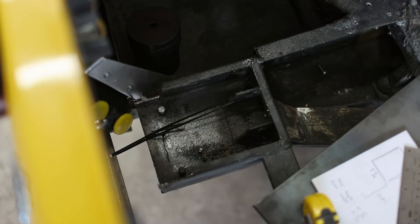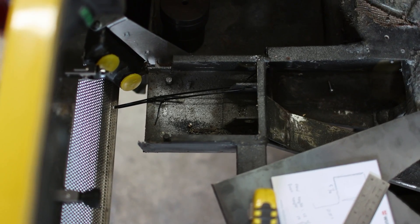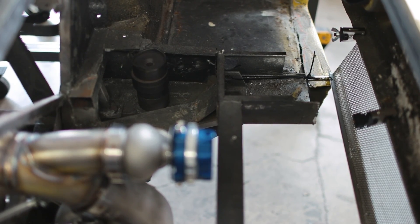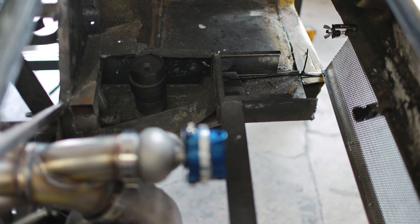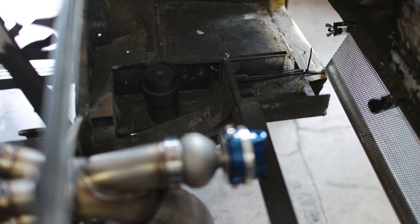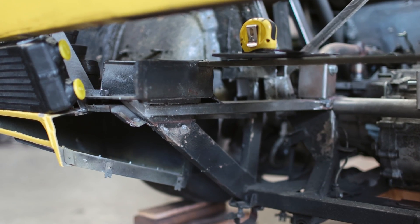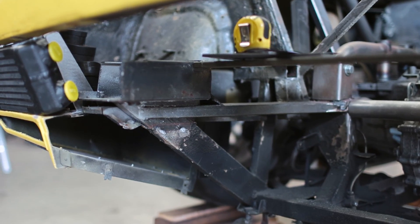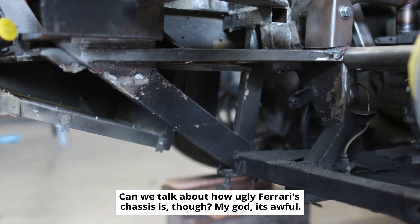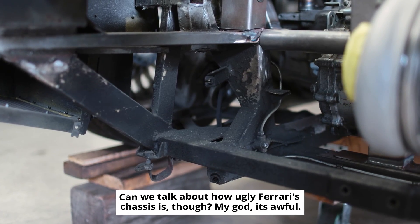I'm taking measurements so that we can start building rear wing uprights, and I've mentioned previously that I'm going to mount those uprights to these boxes at the back of the chassis. They are originally rear bumper shock mounts, which means they are heavily reinforced and tied into the chassis rather extensively — perfect for what we're trying to do. We need to transmit a lot of downforce down to the ground effectively, without wasting energy flexing the car. You can see just how well tied in these points are, with a lot of tube work tying into the main chassis rail underneath, vertical members, horizontal members — this thing is incredibly robust and perfect for supporting a spoiler.